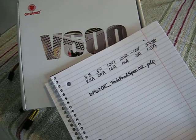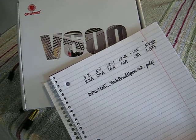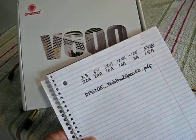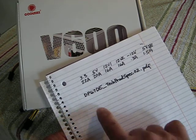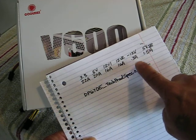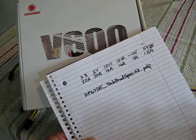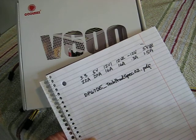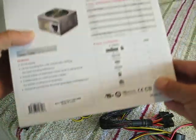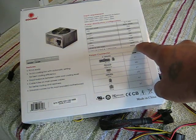For this particular board, they say that if you're going to have one optical drive, one gig of RAM, and one video card, 460 watts is the minimum. They also tell you what current draws they want you to be able to pull for the different voltages: 3.3V, 5V. Here are a couple of 12-volt connectors, negative 12 and 5-volt SB, which is standby, and they are picky about that — they want you to make sure that's sufficient.